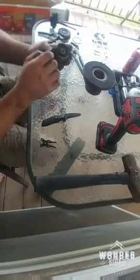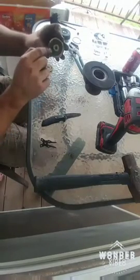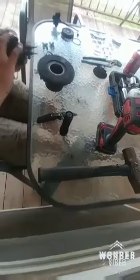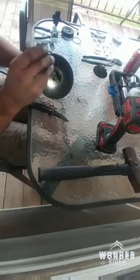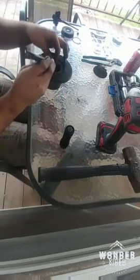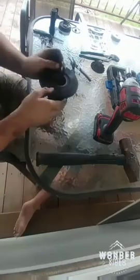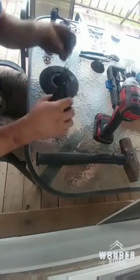This is the first washer, this is the oil deflector plate, and there's a washer here. When we go to reinstall this we're going to replace the oil deflector plate and all of this, plus the thrust washer itself - just remember which way they go. There's a rubber O-ring in here that we need to take out before doing snap rings because we're going to replace it with an O-ring from the kit. You may need to grind the tips of the pliers down to fit in the small holes of these tiny snap rings. When you finally get them out, be careful they don't go flying off.